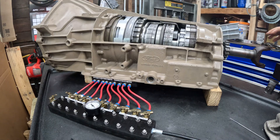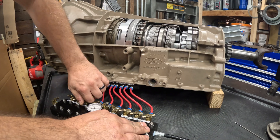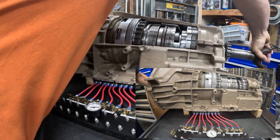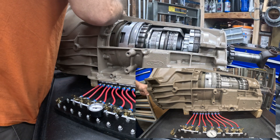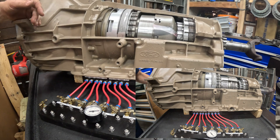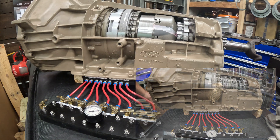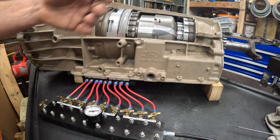One full turn. We're going to do overdrive real quick before this battery dies. There it is — that's applied. One full revolution. Our expected ratio is 0.71. I'm getting a little over 25, about 25 and a quarter teeth — I got 0.71. I actually got it right that time and I don't think I needed to apply a load — everything was engaged so there was no need to put drag on it.